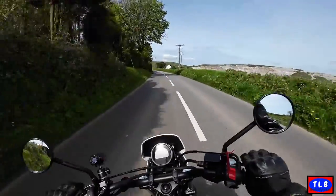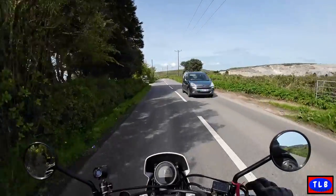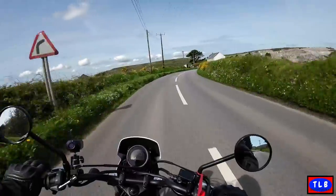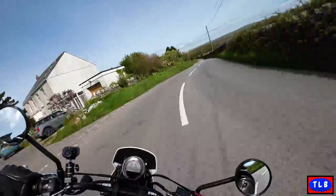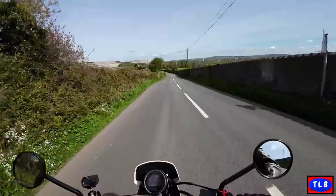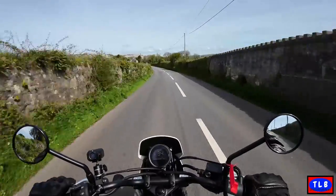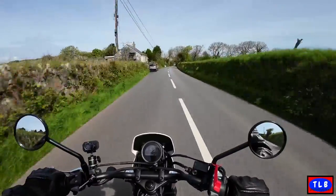Same again, 45, nothing behind, all clear, front brake. Bit of fork dive, which you'd expect. Slightly longer forks than the Rebel. It's okay. I'll just wait till we get round the bend and I'll put front and back on while we go down the hill. Here we are, going down the hill. Steeper than it looks, front and back. Yeah. As I applied quite a bit of force to the front, the back lifted slightly. There was a certain amount of pulsing through the ABS, but it wasn't too bad. So here we go.